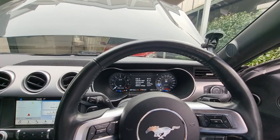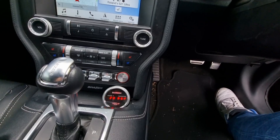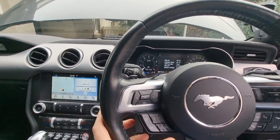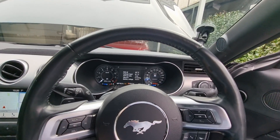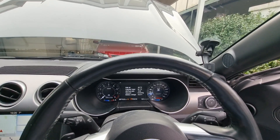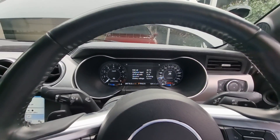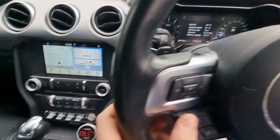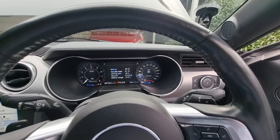If you look at that — we'll go into edit mode — and look at that: E30. It's basically matched exactly what's on the sensor. You can no longer manually adjust the ethanol percentage; the converter has taken over. It'll flick between E29 and E30 depending on what the system is reading.